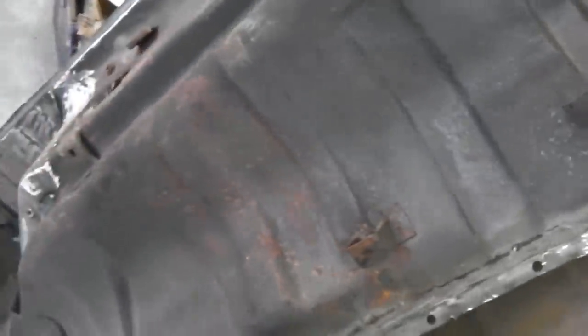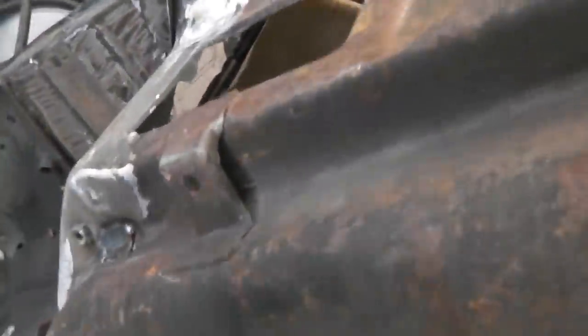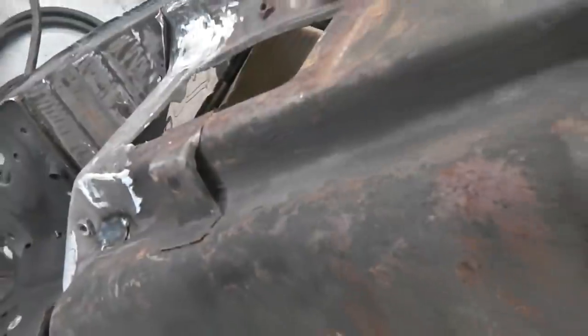It's got different heater brackets because it's off a facelift. The demisting vents, the windscreen vents, are angled slightly differently, the way that the land behind the dash and the bulkhead. So we've got to alter the brackets. We've also got to alter the angle of the fixing bracket here for the air distribution box. There's a few things to remember to do on that, but essentially they're just minor jobs.